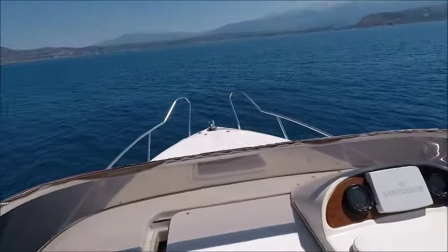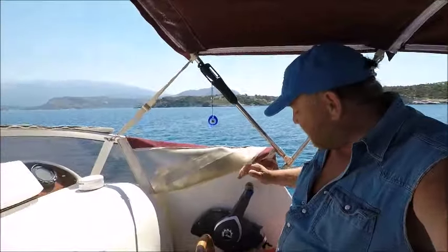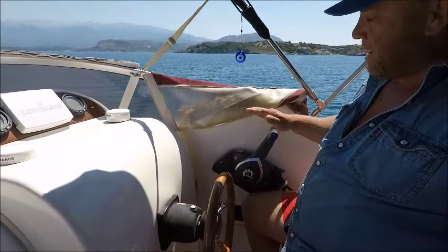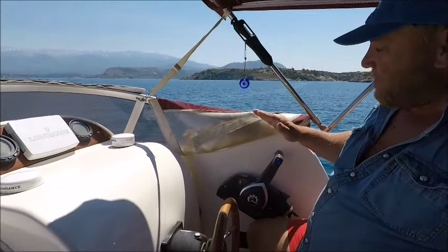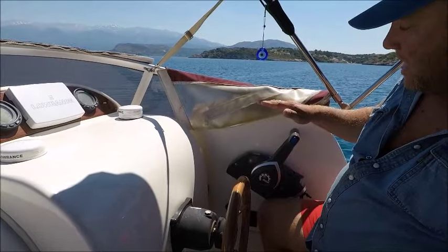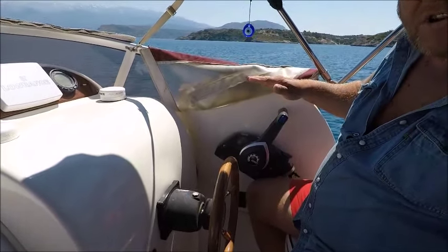All of this front part of the boat will actually be out of the water. So once again, I'm going to go whoosh, then tilt up. That'll bring the bow up even further. Then the bow will slowly go down a touch because of the weight of the boat. Then I'm going to tilt the engine down to basically level the boat out on the surface of the water.